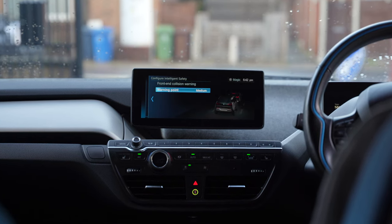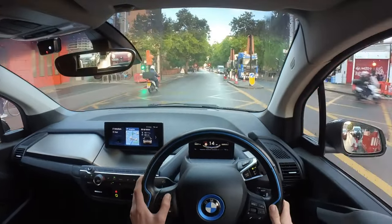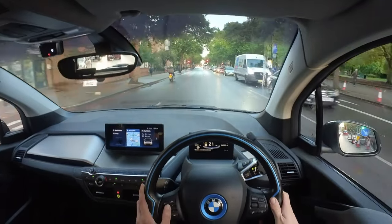you can try to pick a car which includes the package, and you just have to remember that at the beginning of every drive, when you want to use cruise control, to press and hold the following distance button to revert to regular, non-adaptive cruise control.